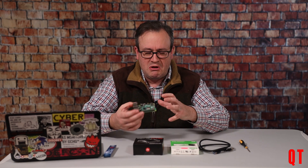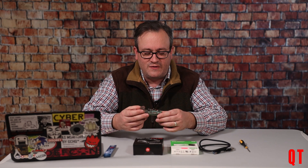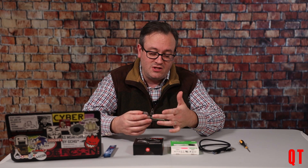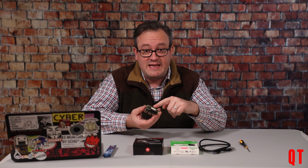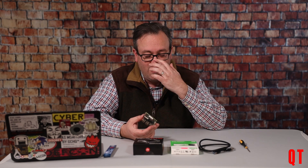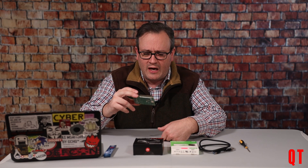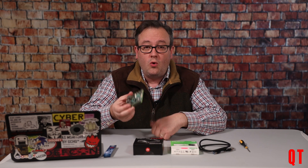One of the things that always annoyed me is that you end up with something that looks like this — a Raspberry Pi in a case that maybe encapsulates part of it, but it's not really all that useful. Because of the size of the board, you've got connectors on this side, connectors on this side, GPIO pins here, and then you're booting off a little SD card. SD cards are fine, but performance-wise they're a bit rubbish. If you're writing to them and treating these things like servers — like I do with the Pi 4, 4 gigabyte — they quickly die.